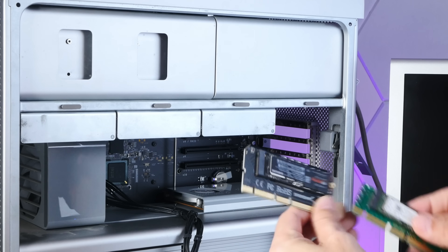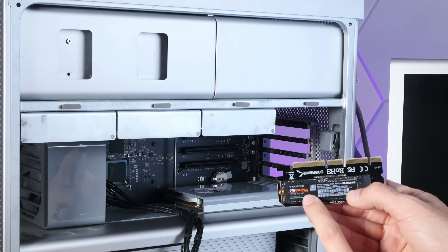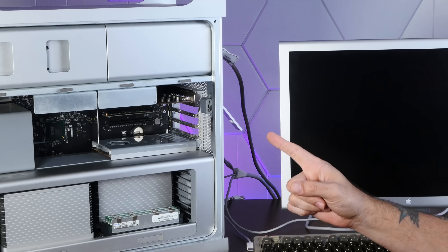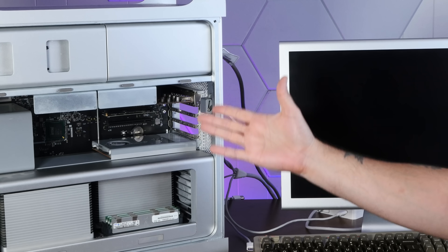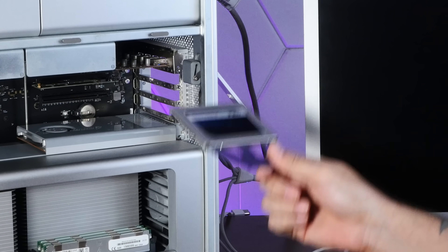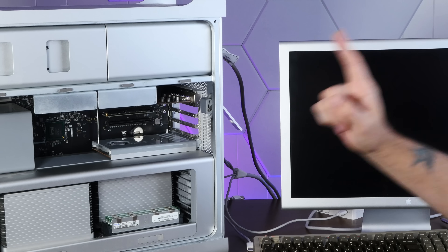I decided to go with this combo, which I believe is pretty much identical to this — except this has a one-terabyte 970 Evo Plus that I pulled out of my trash-can Mac Pro, and I think that should be quite fast. The most reliable way to get this thing booting Linux off of NVMe is to use OpenCore Legacy Patcher. We'll install macOS on this SSD — which the Mac likes to boot from with OpenCore — and that way we can select either booting macOS or booting off the NVMe to get maximum speed in Linux.